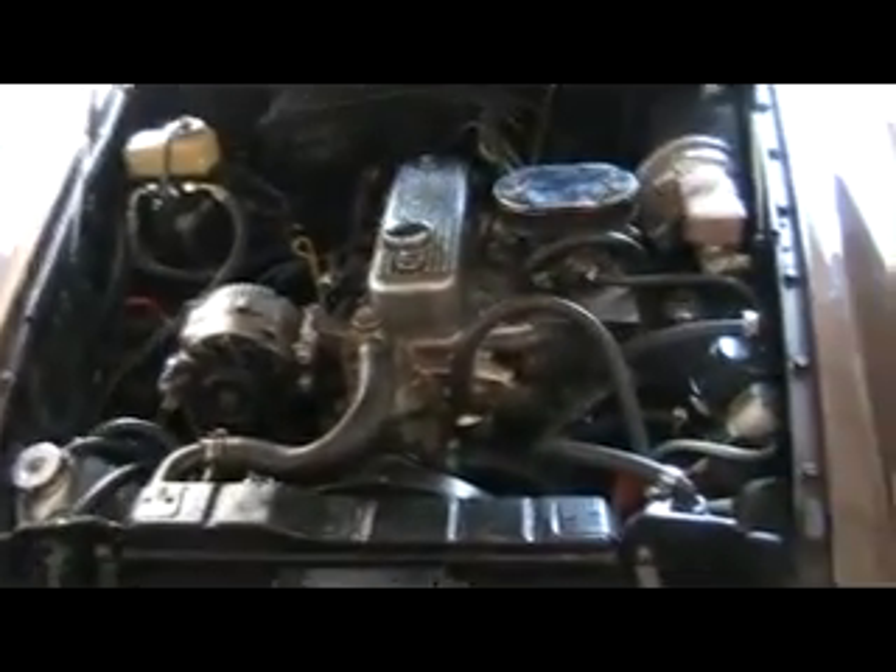Hi, this is Tom again — Tom, the inventor in paradise. I've been working on my MG. We just got through with the thermostat a while ago. When I was there, I mentioned that I took out the fan that was in front of the motor here, and I replaced it with electric fans because I have AC in this and I really want to get a push of air through my radiator and cooling system.